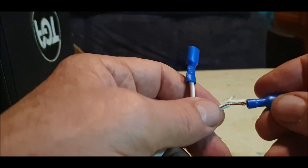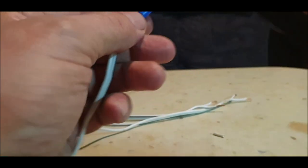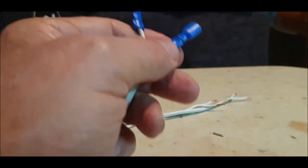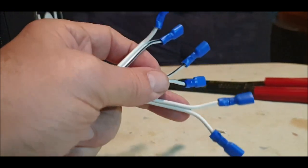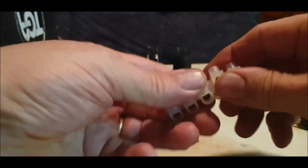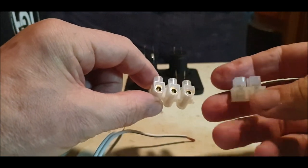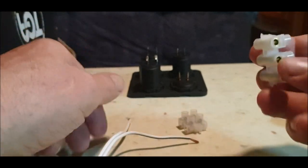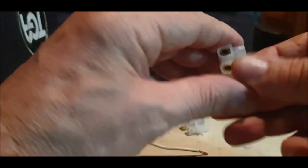All right, same again, push him in. Blue, crimp. Okay, three crimped. There we go. Okay, strip the other ends. What I'm going to do is make three live block connector and two for the neutral. There's not much going to go in. It's only a one-way switch on this, really, and some USBs just to charge his phone in the shed. So done that.